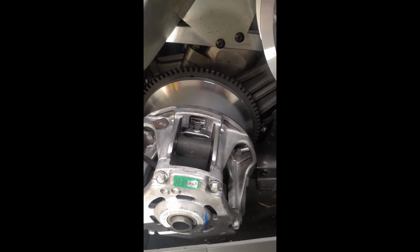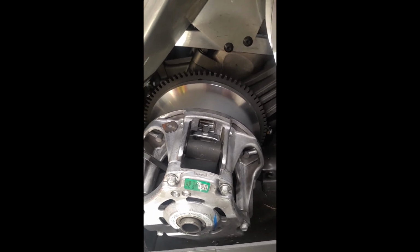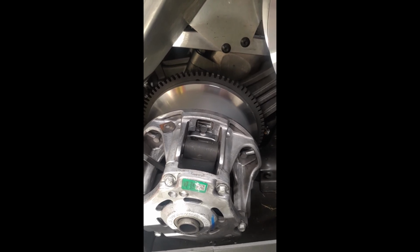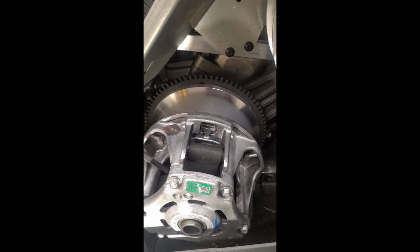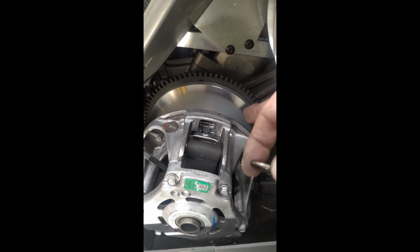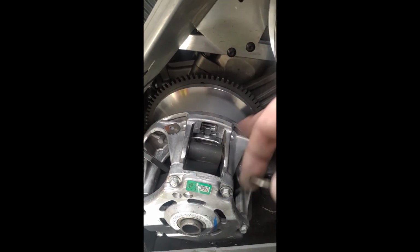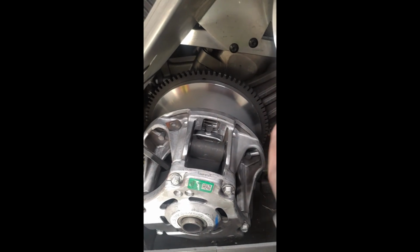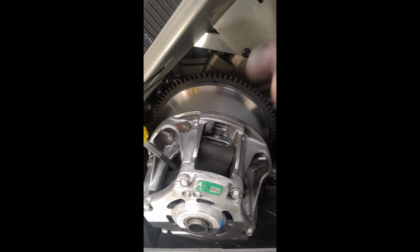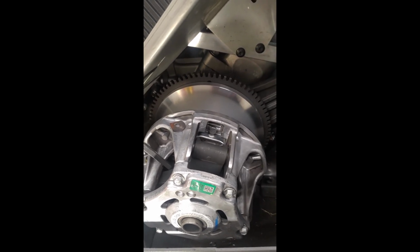but I'll show you the end result after here again, and why it's going to be a lot better to do it once, and I could just adjust all the time instead of in and out. My 13, clutching is a lot worse, but I found switching the weights was a lot easier because they don't have these spacers, but they got those stupid set screws. Those set screws are no good either, that sit on the pin.